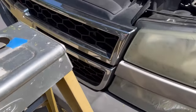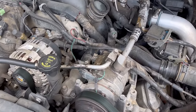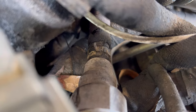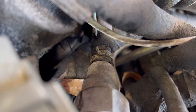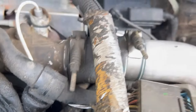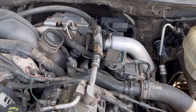I got my stepladder out, climbed up into the engine bay, and of course all of you who own a Duramax know this is what you're looking at. I started looking for wet spots, and I found a tiny little stream of antifreeze coming out right there. See that wet spot? There was a little stream of antifreeze coming out right there. And that connects to this pipe that goes over to your thermostat housing right there, and then goes over and connects up underneath one of your turbo pipes. But that's not head gaskets, so you can bet I said hallelujah.